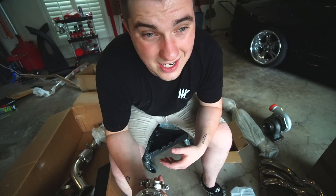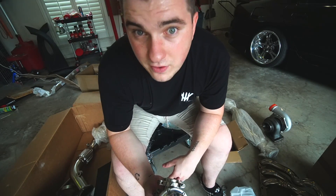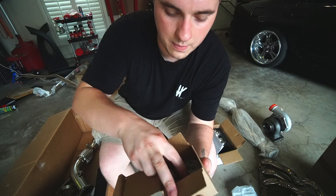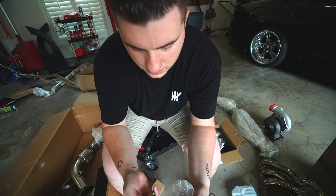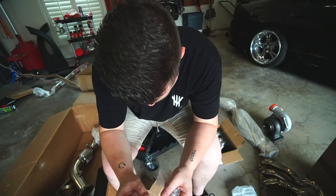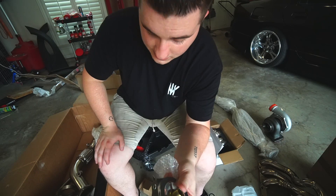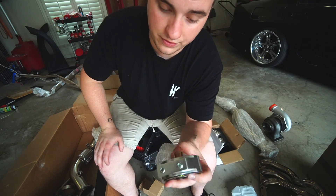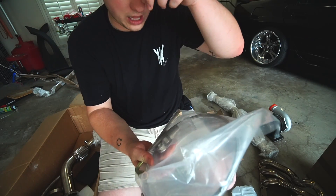We won't need a big spring. 2JZs can make 500 horsepower on 15 PSI, so we don't need that much boost. I've got a bunch of miscellaneous accessories — there's an oil filter adapter in here. I've never seen this device before and I've done a lot of turbo kits. It's something with the oil filter, but that's all I know. They do give us some oil lines, but I'll probably go ahead and buy my own — I think it's important to get some good braided lines.